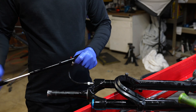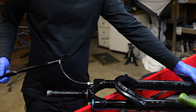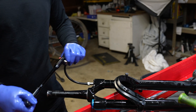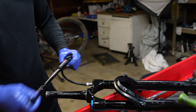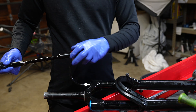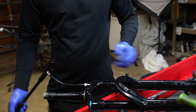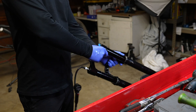Before you put any tools away in this oily mess, fill the fork up with like 30 psi so the travel fully extends and cycle it a bunch of times to make sure you didn't do anything wrong and everything feels smooth. That's how you change the travel in your Fox 38 — it's pretty simple and easy. Now we're going to rewind in time and do the full damper service — or rather, just change the fluid within the damper.